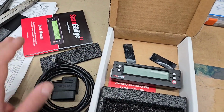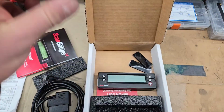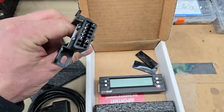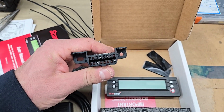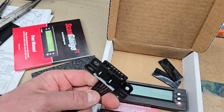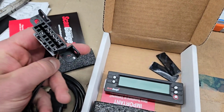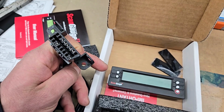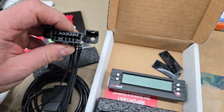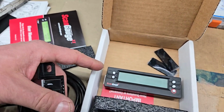So we'll see. As far as integrating it into the car, I got this from another project. It's an OBD port. It's not pinned correctly for this, but I could swap some of these pins around. I'll depin and repin it. I'm probably just going to leave this in parallel alongside the existing CAN bus port. Also, there is constant 12 volt to the OBD port. I don't really like that. I think I'm just going to use a 12 volt key or accessory source so that this will only power up with the car.